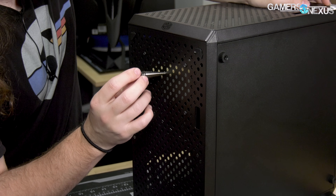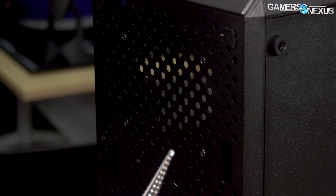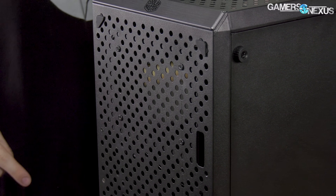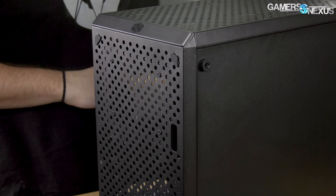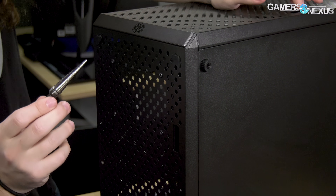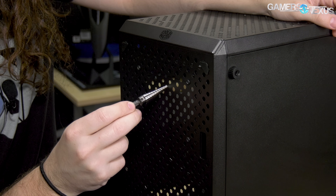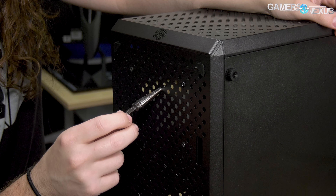But we're going to get rid of all of that advantage today and drill each one of these holes to be wider. Originally, the idea was to take a Dremel and just cut a giant gaping hole in the front and stick a mesh cover over it — you'd probably have something that cools pretty well. But since that's clearly not feasible for Cooler Master, we're going to try just widening the holes. This will make the panel structurally weaker, but we care more about airflow.